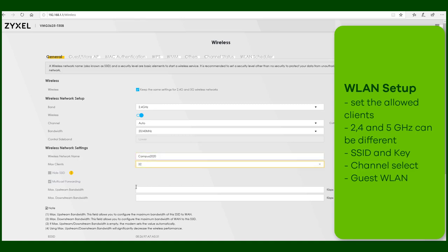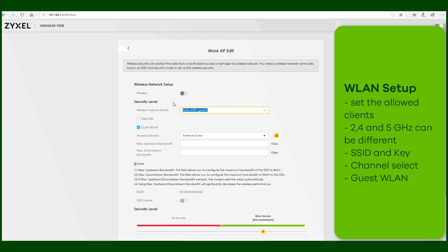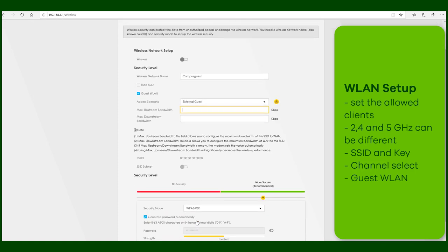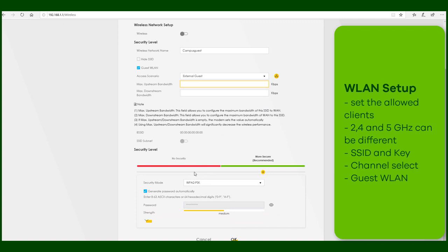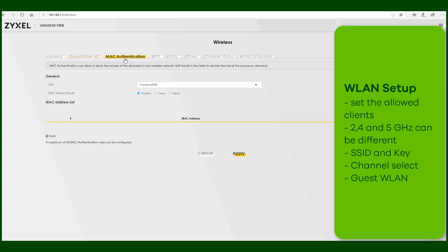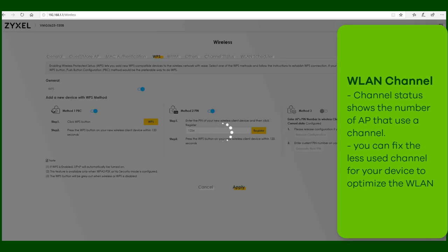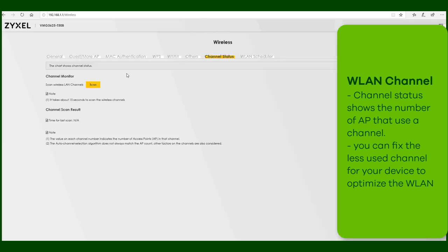In the menu Wireless, you can change the number of clients that have access to your SSID as well as you can enable a guest network using a specific SSID and security for specific clients or client groups. Simply enter a new name and a way to connect to this device. You can also choose the security that guests should use or disable the security. You can also change MAC authentication or WPS access to the network so that it is more convenient for other clients to connect. Please refer to the user guide before you apply changes.